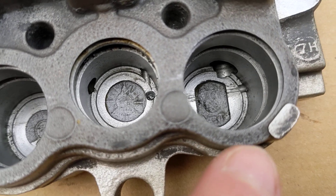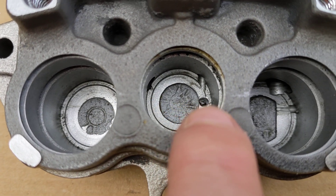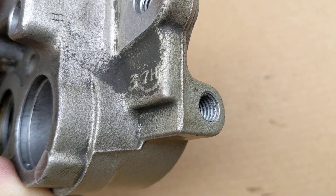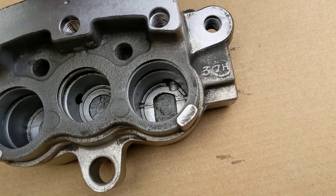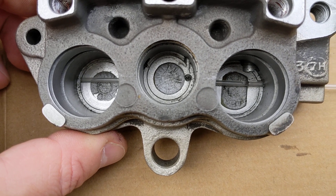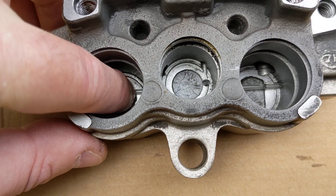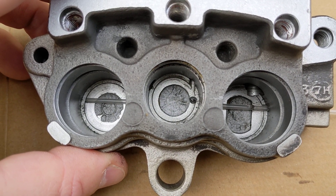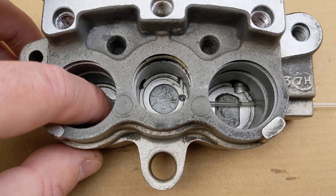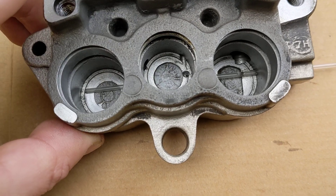How I did that was I basically right-angle marked up to here, right-angle marked up from there to there, then dropped the line down, marked that hole, and drilled on that flat surface. If you look at that bleed screw hole, it lines up all the way through — that's how the bleed screw is linked through the two top and bottom pistons. The middle piston doesn't go deep enough, so essentially you're just drilling through the base of the center piston until it links up with the gallery which runs between the top and bottom pistons. It's not about flow, because fluid volume doesn't change much when you apply the brakes — it's about pressure. This gallery is somewhere between a 2.5 and 3mm hole, so I used a 2mm, then a 2.5mm, then a 3mm drill to gradually step that up and get it as close to center as possible.